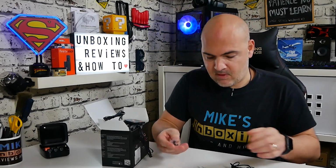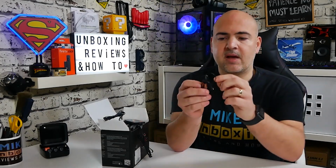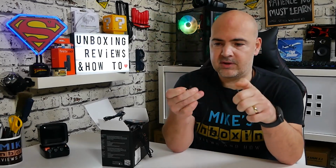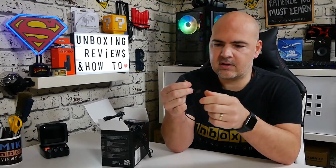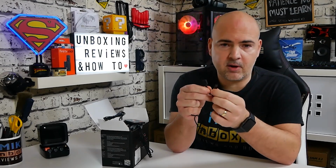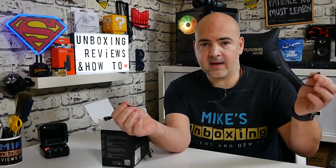So next up is some of our mounting hardware. So you get 3 packets of screws, obviously 3 fans, so that kind of makes sense. And also you get your pass-through cable. So one end connects into the controller itself, which is this 3-pin section, and on the other end you've got the option for the standard 5-volt 3-pin connection, and also there's a pass-through for the VDG, which is on some Gigabyte motherboards. The extension itself is around about 18 inches long, so should give you a lot of room for wiring in your case.